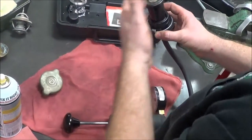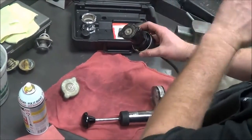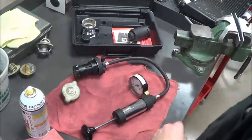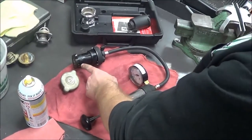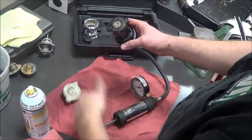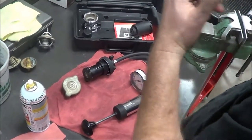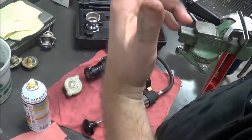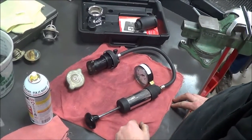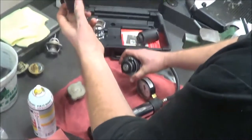Per your service manual there will be a specification for allowable pressure loss — something like 1 psi per hour. Honestly I don't have it memorized. What I do is think about my diagnostic process: if I need to test a radiator system I'll hook this up and let it sit for a couple of hours. A good cap can sit overnight and won't leak at all. If I come back after lunch and it's not leaking, it's good — then I move on to do the radiator test.